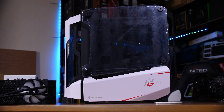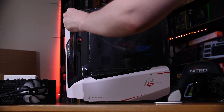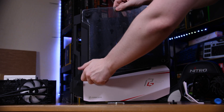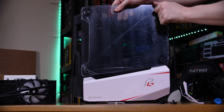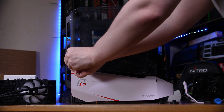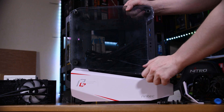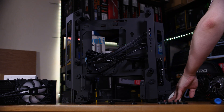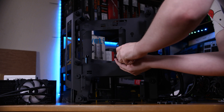We can put the motherboard to one side and start working on our case. Take off all of the panels to get access and install all of our hardware. The two tempered glass side panels are held on with large hex or Allen key bolts — they do include an Allen key in the box. Remove all eight screws to take off those panels, then pull the lower panels off as they're just clipped in. The front panel that hides our graphics card is held on by two screws, so remove those and take that panel off.